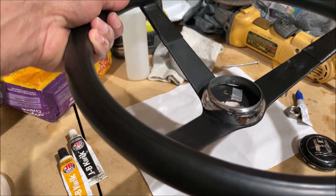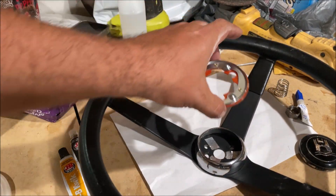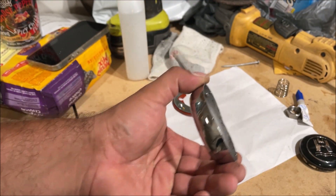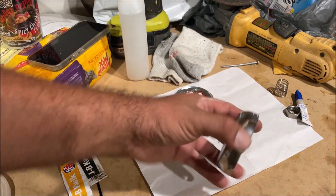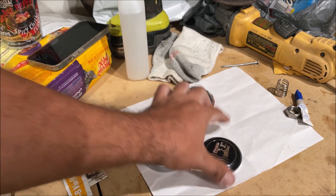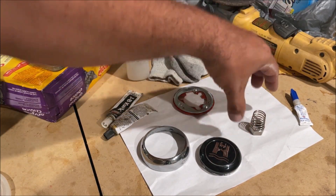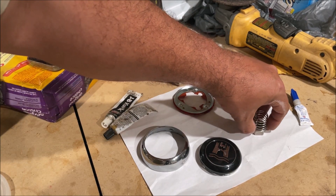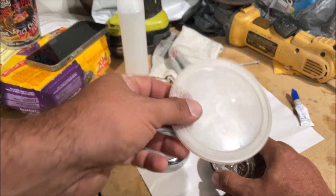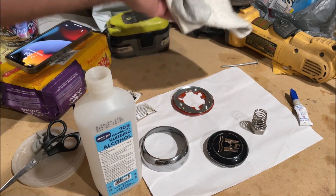Custom cut it where it wasn't hitting these two spots — as you can see, this thing fits in there flush now. It was not doing that at all. You've got to mark your center. This piece came off and on about 30 times. I did test it, it was beeping. Then I had to reclock it — that's the top. We're going to JB weld it, and also JB weld the spring right there. The socket fits over it and compresses it without affecting it. I don't want that spring coming out. We're going to cut a coffee lid out and just super glue it.